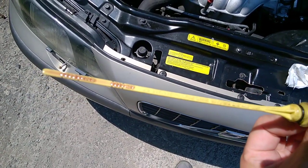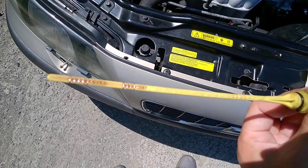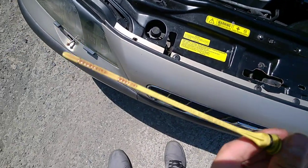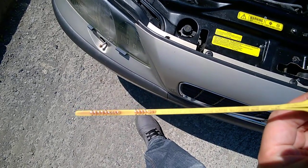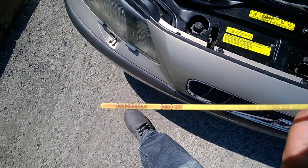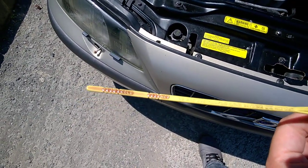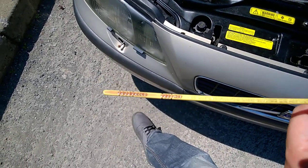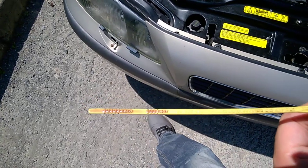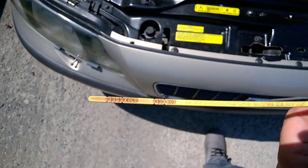Between the min and max — this is the max level, this is the min level — this is for hot fluid. The cold fluid level doesn't really matter; I don't think you need to use it. Some say Volvo mechanics use it when the engine is fully cold and they refill the transmission, but I don't believe that. Always check only the hot side mark, and check that you have fluid within that range — and that's all.